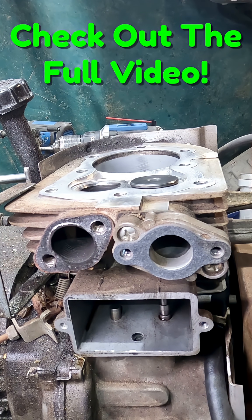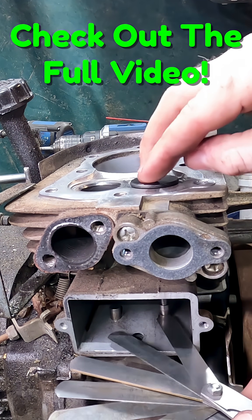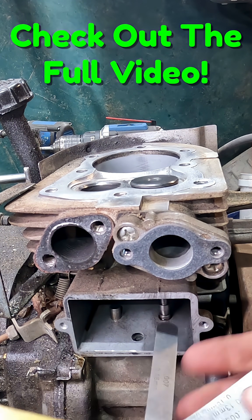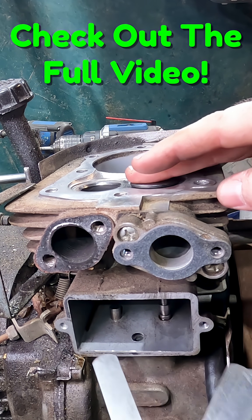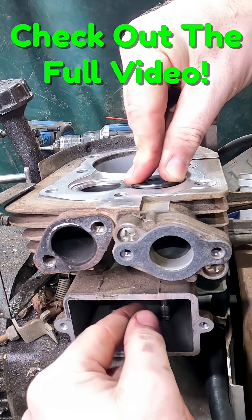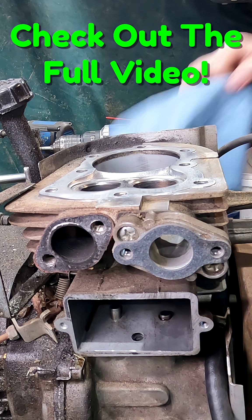We removed a lot of dirt, so we want to make sure we have a few thousandths of valve clearance before we begin. We've got five thousandths — let's confirm we have six or seven. Yep, seven there. Because if you're bottoming out, you're not going to be grinding anything, you'll just spin.